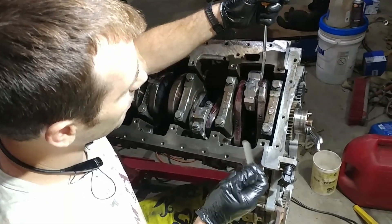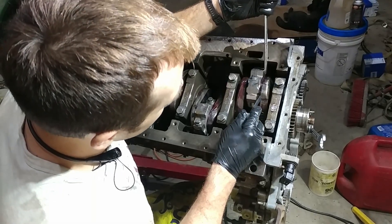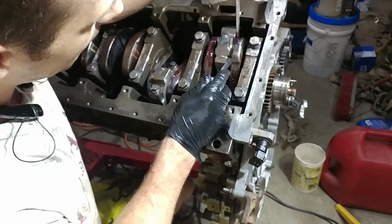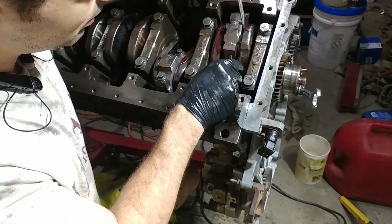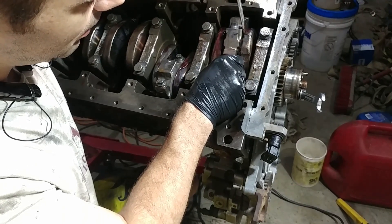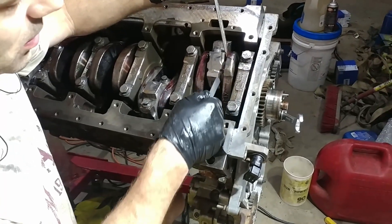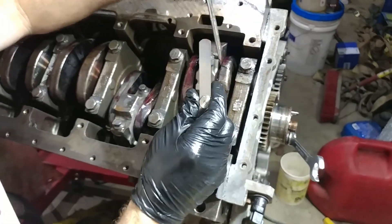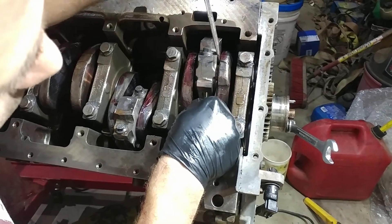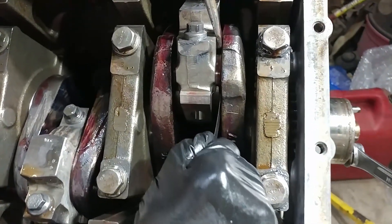What we're doing now is checking the side clearance on these connecting rods. We're carefully going to come in here and put some pressure, just like we did for the crankshaft when measuring the end play. The spec on this is between 4 to 12 thousandths, so there's a pretty wide range. This is a 4 thousandths feeler gauge here, and I can get a 4 down it — it's still a little bit snug in spots, so this one is nice and tight.